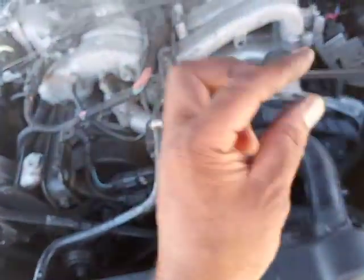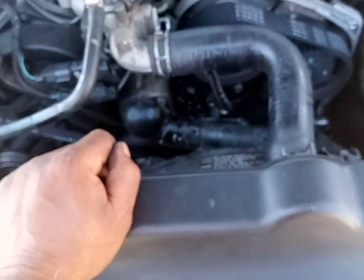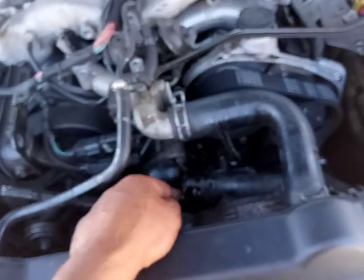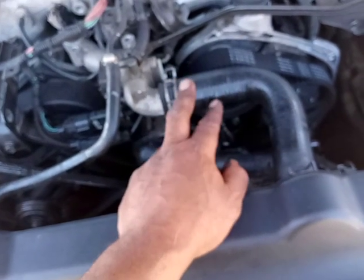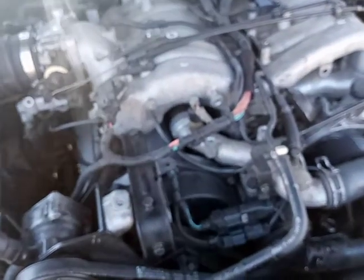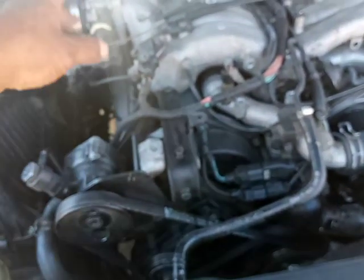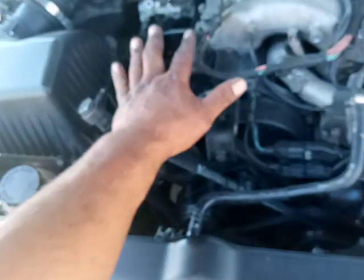And if one is off just by half a tooth or more than a tooth, timing is completely off. And I really think that's what happened, because they can't get correlation. And mind you, this all has to spark uniformly. Cam and crank have to be uniform. If it's off, it's still going to spark, but it's going to delay. And you see what's happening. P0300, random misfire. Random misfire, but it's shutting down 1, 3, and 6. 2, 4, and 5 staying alive. So this bank is working, this bank is not.